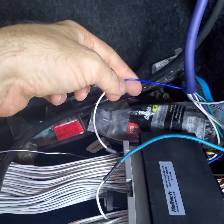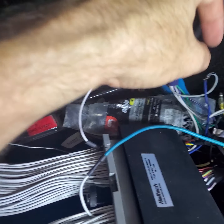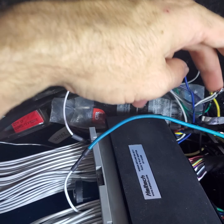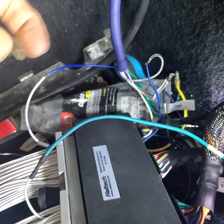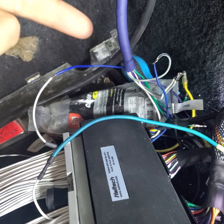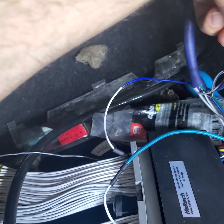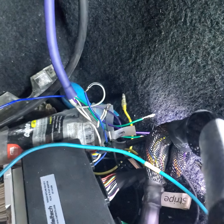Oh, but that's irrelevant. So I'm running a new wire. I've got it going into a 9-wire strand. I've got other sensors, my 5 volts and grounds. Then I've got from the ECU going to my fuel pressure and oil pressure sensors. So got that going on. Haven't actually gotten those two in the ECU yet, but still working on it.